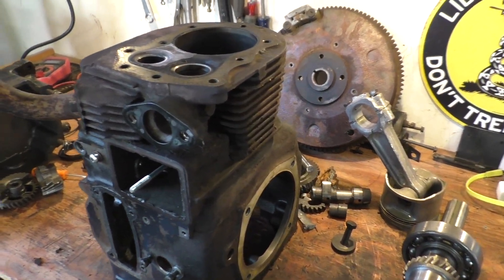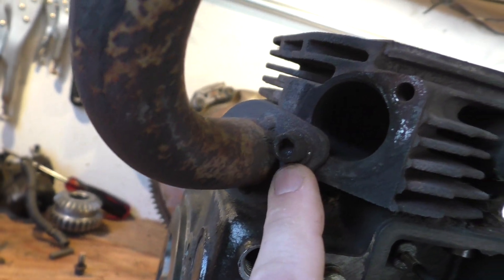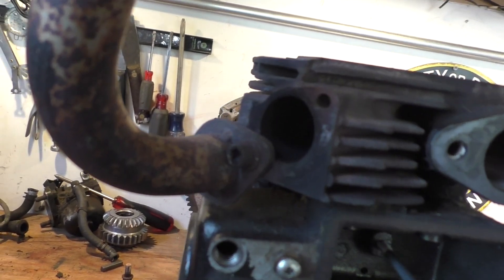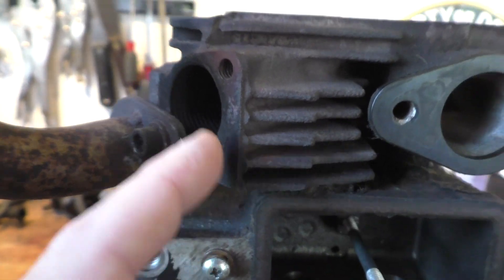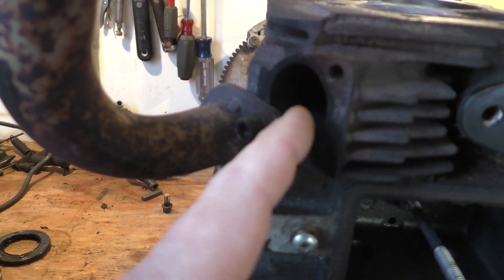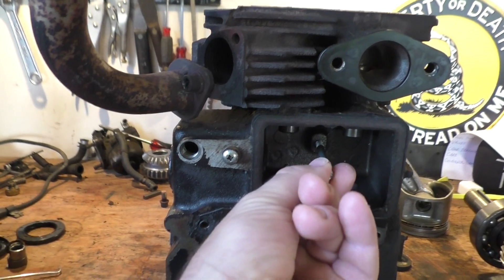The motor is taken apart and all the parts are out. The one thing I haven't done yet - because it's not my engine - is deal with this stripped stud. Someone was in here before because this is stripped out. The other side a quarter-inch hex gets it out no problem, but my quarter-inch hex wasn't working there. Also there's no gasket here, so I think what I'm going to do is grind that off, put a pipe in there, and mate it up to this exhaust pipe and this old beat-up Gravely muffler.